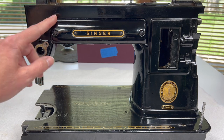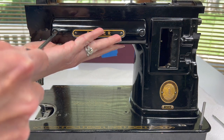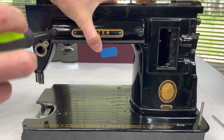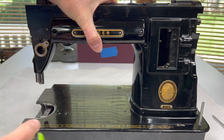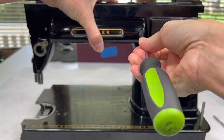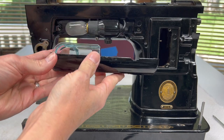So to just jump right in, I am going to remove the lamp cover here. Once I take it off I disassemble it a little bit further to clean it, but there's just two screws that hold it on on the 301A. You just want to keep a grip on it because you don't want it to fall down onto the bed of the machine. Most of these machines have already seen their share of wear — we don't want to make it worse. The screws shouldn't be too tight and they just screw out. They're longer screws and the lamp shade should just come off like that.